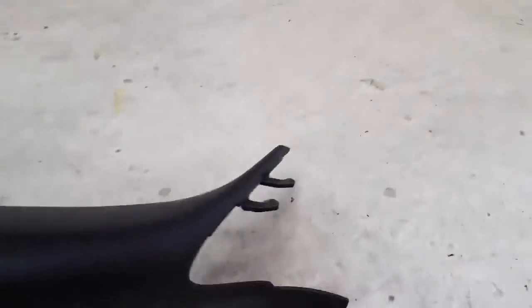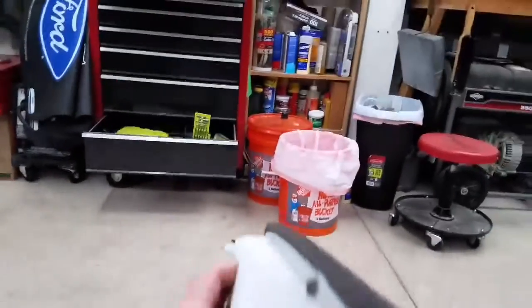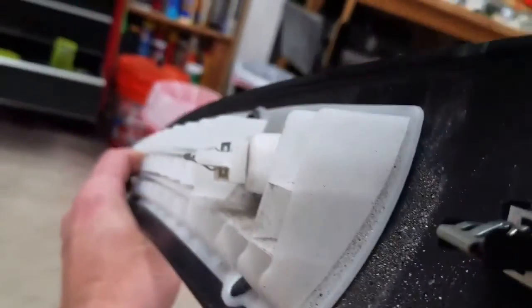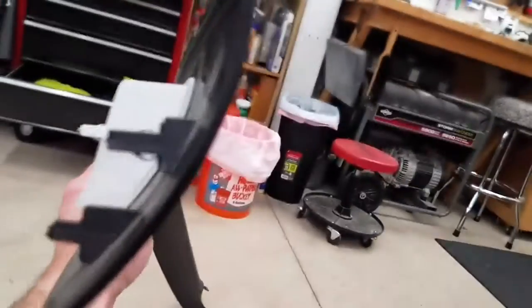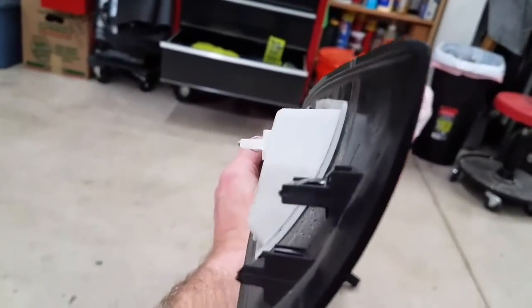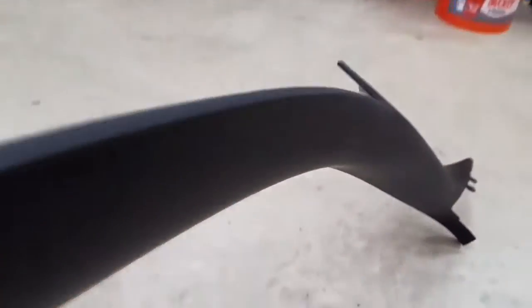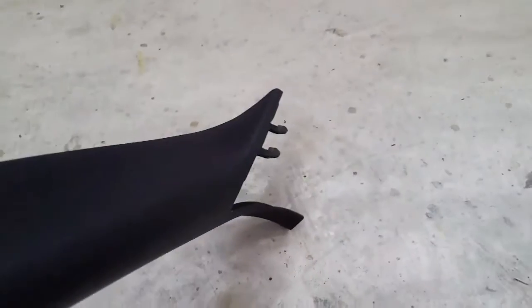Now the whole thing's loose and it's just held in by this, and that just comes right out of your dash, just like that. It'll reinstall in the same position — keep it lined up. These mostly go in horizontally. So when you're doing it, it's more of a horizontal outwards motion, less of a downward. You think you want to pull it down at an angle, but you don't. You see that those really want to pull out in a sideward direction. So get your fingers under it, pop, pop, pop, pop, and then pull it straight out.